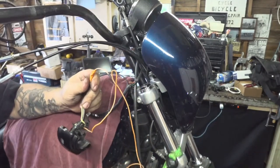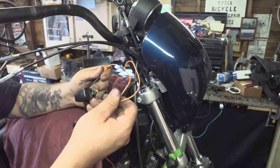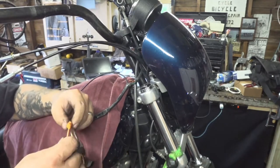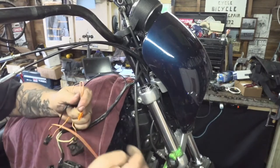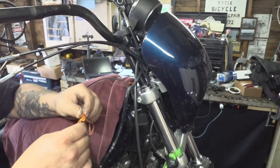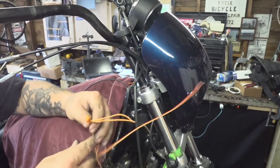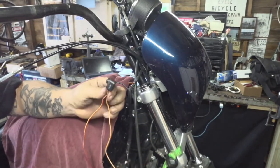There it is out the other side. We found there's actually a little jumper in here — the power that runs the brake light also runs the turn signal. That's probably the feed power coming in. Interesting, I would not have expected that. So we're going to have to tie all that back together. In the meantime, we can peel the electrical tape off and undo our connector. Now we have a pull wire for when we pull the wire back through the sheathing.